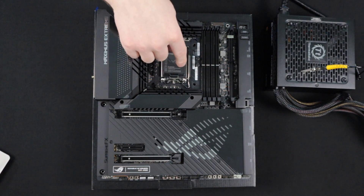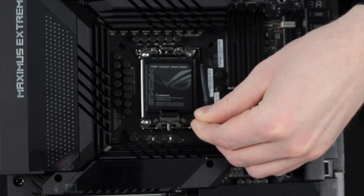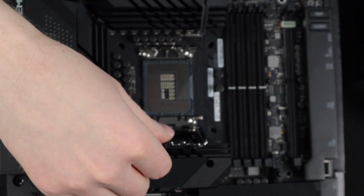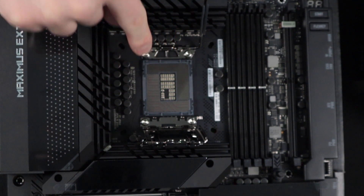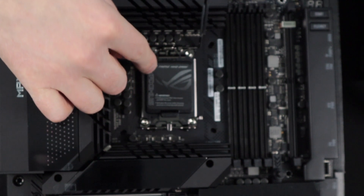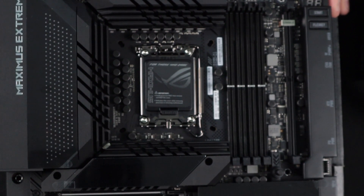The last step in the visual check is going to be to look at the pins in the CPU socket. We're going to push down and out to get it out from underneath the hook, keeping pressure on it so that it doesn't spring up, as it is spring loaded — we don't want to damage the motherboard. The CPU tray will swing up and reveal the LGA land grid array where your CPU will sit. Once you have access to the pins, you can make sure they all look straight and that there aren't any missing. Once you're satisfied, you can shut the CPU tray with the protective covering over top, pull down the latch, push it under and over the hook, and your protective covering is back on your CPU socket.